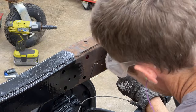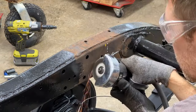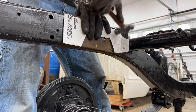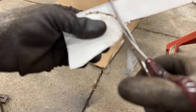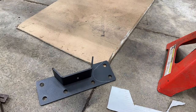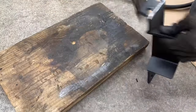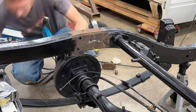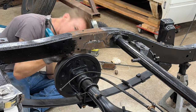The inside edge of the frame is thinner than the outside on these old Toyotas, so it cut pretty quickly with a cutoff wheel. I considered cutting the mini notch to clear this extra bracing on the frame, but I didn't like the idea of removing all of that material from the mini notch. So I decided that I would trim just a little bit off the front of the mini notch. Now I needed to finish the cutout to test fit the notch, and I decided to use the sawzall to do the two straight cuts across the underside of the frame.